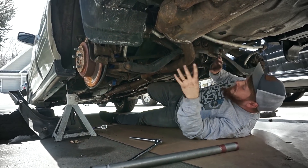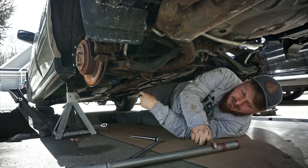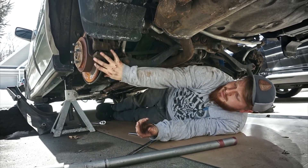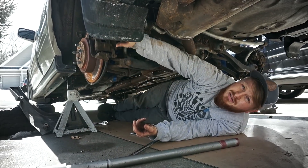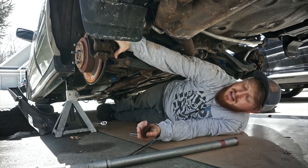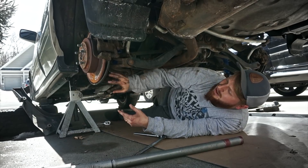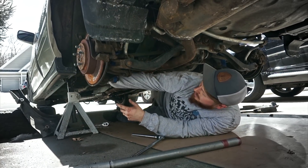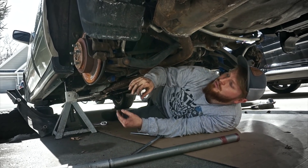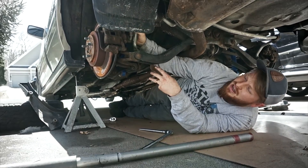I'm going to retrofit the Ford rear differential into the Subaru subframe using the stock Ford Explorer axles. To do that I'm basically going to make a whole new custom knuckle. I'm using rear brakes from a 2015 Ford Mustang and a wheel bearing from a Honda NSX - which is the Honda supercar. On this body style the rear knuckle is one piece with the trailing arm, so I'm building a custom trailing arm knuckle.